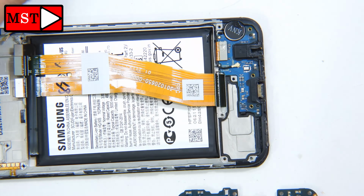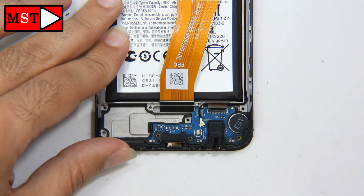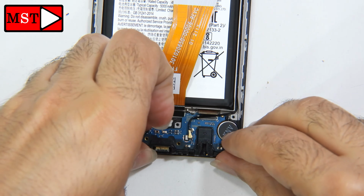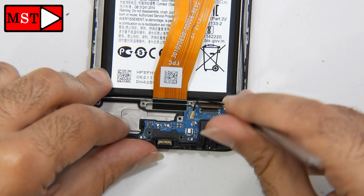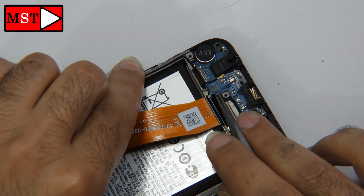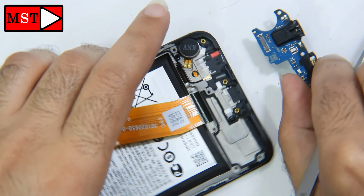We have water at the flex cable connected to the charging sub board, connected to the main board. So we have one flex cable that comes with the screen. That screen comes connected to the sub board and the same flex cable connects to the main board, so you just have one cable. Alright, let's remove the sub board. We are going to see the damage that may have been caused there. I don't think there is too much damage.